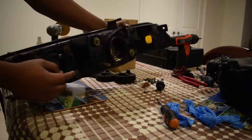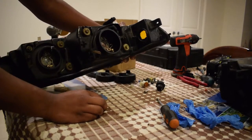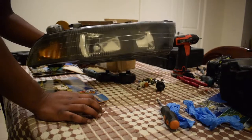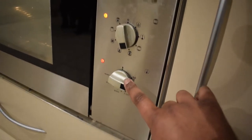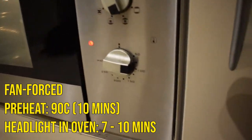I've removed all the bulbs out the back and you also want to make sure you remember to get your parker which is hidden just underneath the low beam. I've wiped the face and all the rest of the lens down with some rubbing alcohol just to make sure it's nice and clean and nothing bakes onto it during the heating process. 90 degrees Celsius and fan forced so that we get all that hot air circulating around. Not gonna lie, I'm pretty nervous about doing this but this is kind of one of those one-shot only things because if you melt the plastic or damage the lens it's kind of game over.